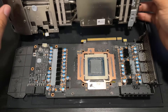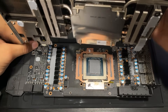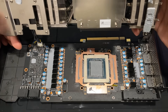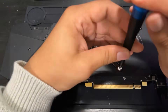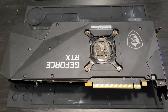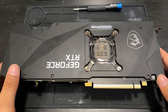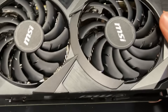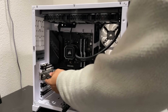Now we've finally reached the point of reassembly, which is pretty simple — basically just do the opposite of what you did to take the card apart. That includes applying the cross plate and screwing everything back together, which is why it's important to keep track of your screws. The very keen-eyed among you may have noticed that this card is bent — and I thought this was something I did, but no, this is actually how the card came. While this did not impact the memory temperatures, it is most likely impacting the core temperatures.